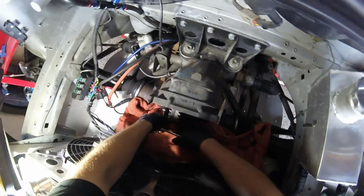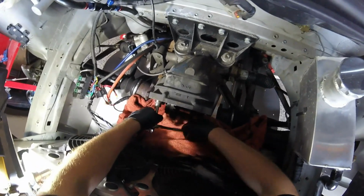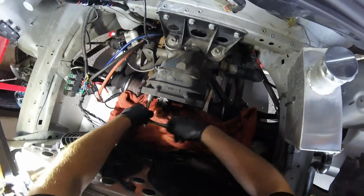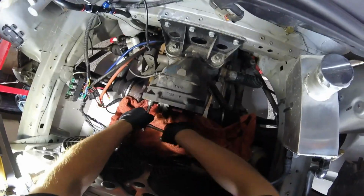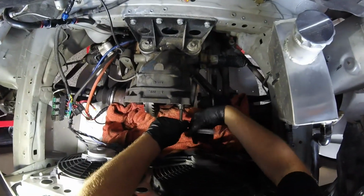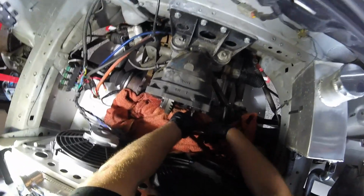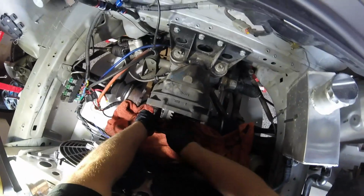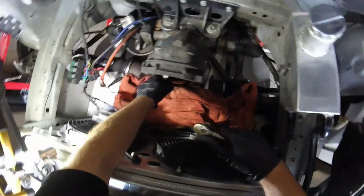make the neighbours grumpy. Just checking that's not binding up on the teeth before we start getting a bit more serious about tightening these down. Now if we look up in the manual, there will be a torque for those bolts, given we don't want another diff failure. I think I'll go have a look at that and get that right. Perfect. That's good.